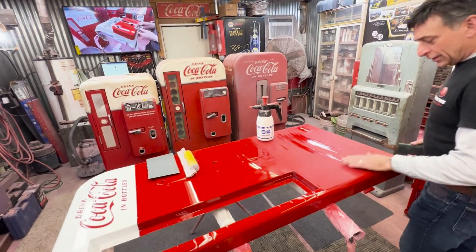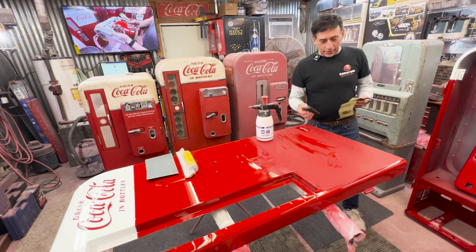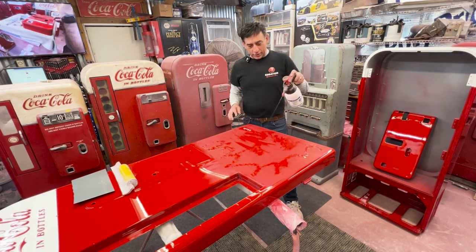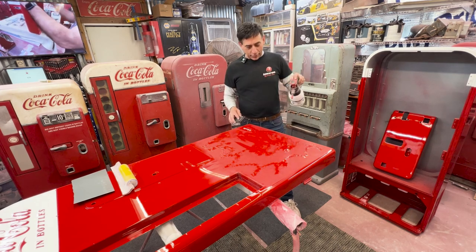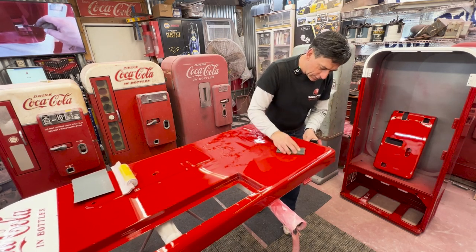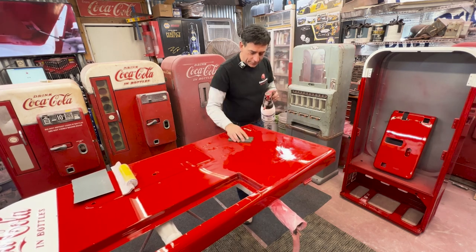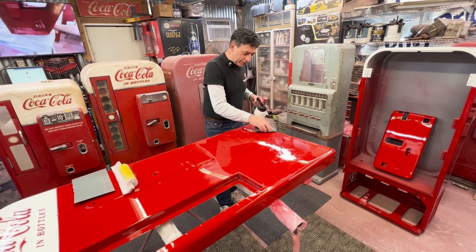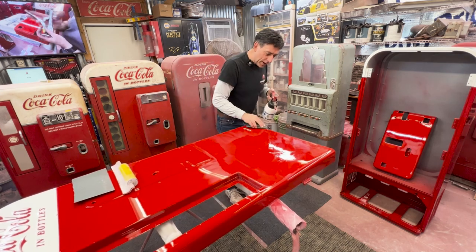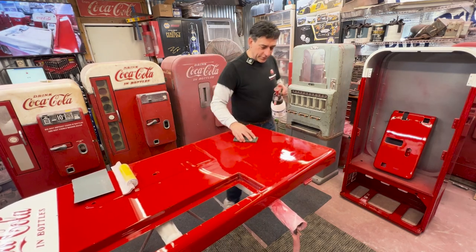Not a lot that's really technical here. I'm using a soft pad and just wrapping it on there, starting with 1,200 grit and taking this down. I always use water when I'm doing my wet sanding — you can do this dry, but I like the process of water, especially on clear coat. Do short strokes. If you get anything in your paper that way, you're not making a big long scratch. I'll spend probably three to four hours just on the sanding part. Keep it fairly wet, do a section at a time. Stay off your lettering, get all the way around it.